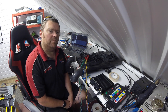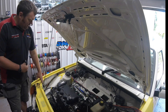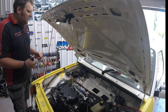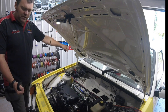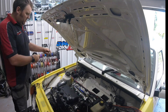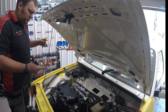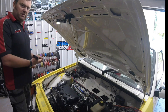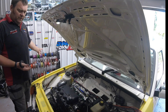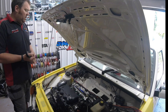As far as I'm concerned, this is a massive improvement for this car. I've bundled all the offside cabling together. It's worth noting that some of the original loom we're still using for the original gauges. After doing some resistive tests I discovered the coolant temperature wire was knackered — no good. It's worth doing these checks on a classic car, because once you've loomed it up it's going to be a pain to get back out. A couple of original wires — the alternator one was already joined in five or six places, so we've replaced that. We've also replaced the coolant temperature sensor wiring back to the original dash gauges, using red with white trace automotive cable — so it's nice and OEM.